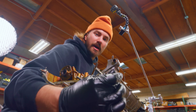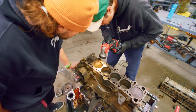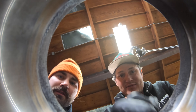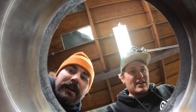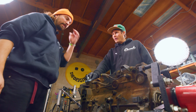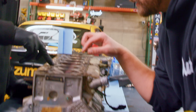This looks pretty good — no scoring, no evidence of oil in the cooling system or coolant in the cylinders. The tops of the pistons look pretty good — everything's clean. So far I'm impressed with what I'm seeing. We have to go deeper, into the belly of the beast. Let's throw the head up there and look at it — look at the head gasket, look at the valves.